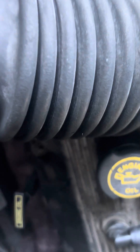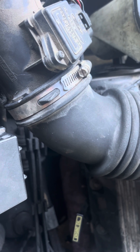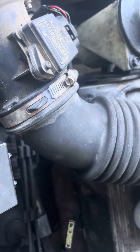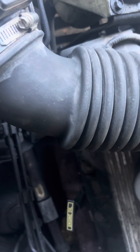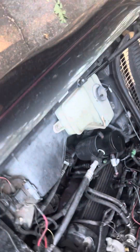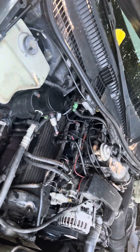We are going to get a motor replacement, and we're probably going to get O2 sensor replacement videos as well. I'm going to finish diagnosing this — checking wiring, visuals, vacuum ports, all that. If I put a new motor in and it's still overloading on fuel, we'll kill the new motor. Looks like we've got a scored cylinder wall in cylinder number five, giving low compression due to it washing the cylinder with fuel. That's my diagnosis.